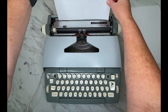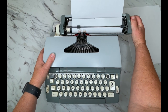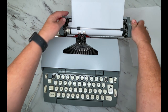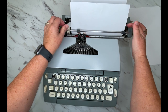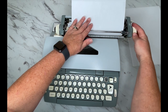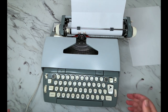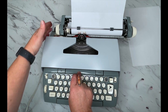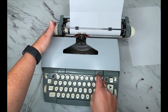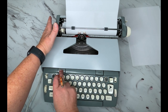To load a piece of paper, just set it there — you don't have to push it down — and turn the handle. If it's crooked, bring the paper release lever forward, adjust it, and re-engage before you keep going. The paper needs to be underneath this metal bar to type properly. You also have tabs down here: hit Clear to clear the tab, and hit Set to set it.